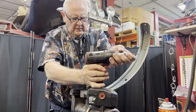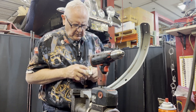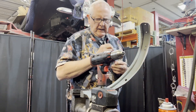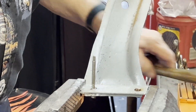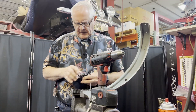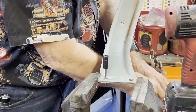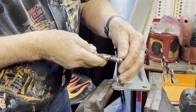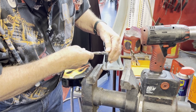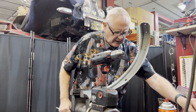We're through again. That hole looks pretty good. Now I'm going to show you what happens when you put an easy out in there — it goes in like that, needs a tap. Then you take a socket that fits over the easy out and use your ratchet. You don't want to break this off, so just go slowly to see if it's going to turn at all. It doesn't want to turn at all — that does not usually work very well.